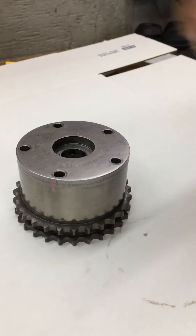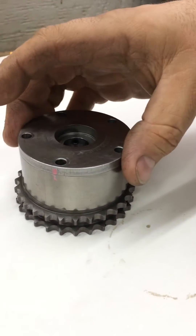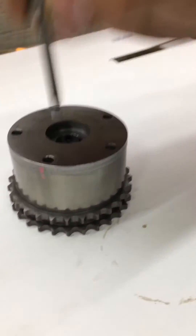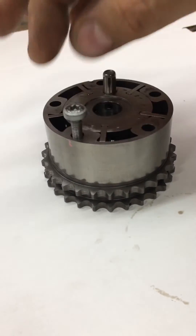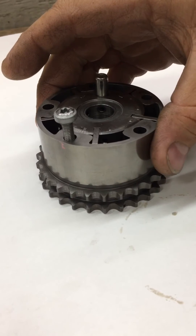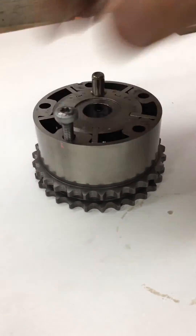So this is not centric — like putting a wheel spacer on a wheel without the center hub. Correct. As you can see, this sits in there, but it really isn't secure. Even when bolted up, there is movement. The bore is a good amount bigger than the size of the bolt.